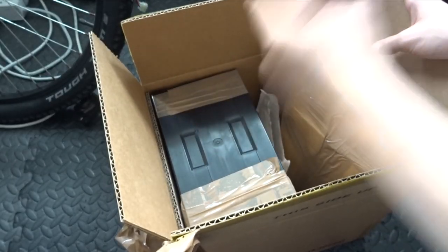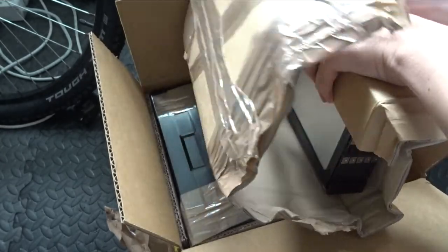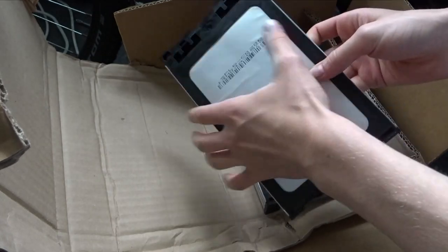In here we have the batteries — not one, not two, but 30 high power lithium polymer cells. These are CO20B cells, designed for racing cars. The company selling them went out of business and sold them off pretty cheaply. These cells have crazy performance: 20 amp hours each, and I'm building a 14S2P pack, giving 40 amp hours of capacity — potentially 50 miles of range. They can do 200 amps continuous, 400 amps peak for 10 seconds. These will be no bottleneck whatsoever for this bike.